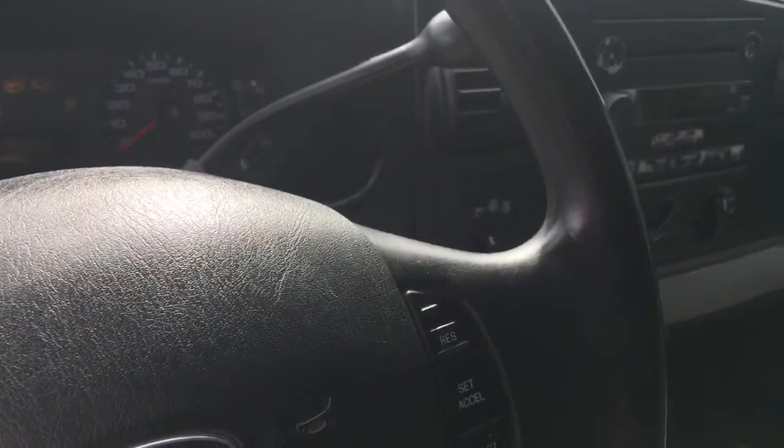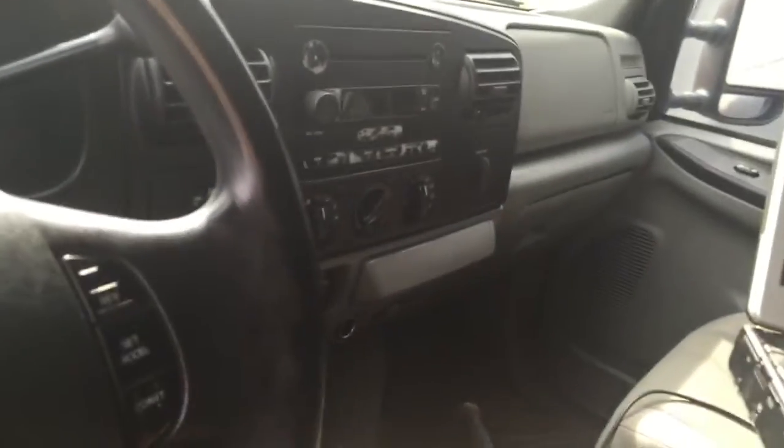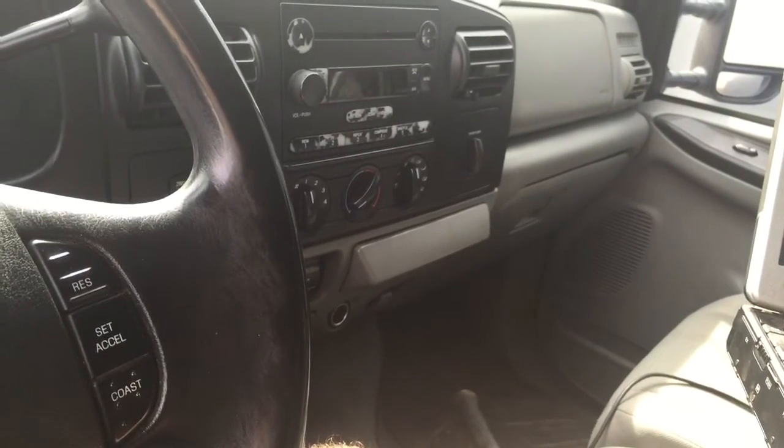Known good IPR test — I doubt it's the IPR. This is an actual leak. With this model year, could be standpipes or dummy plugs — probably dummy plugs or STC fitting. One of them.